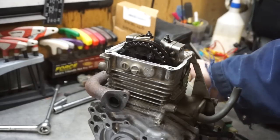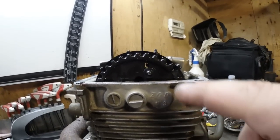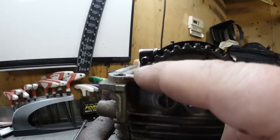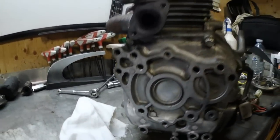Once the valve stopped moving, there are two timing marks. I turned it back just a little more and we achieved top dead center right there — one little mark there, one little mark there. We're right at the top, and now we can remove all those bolts.